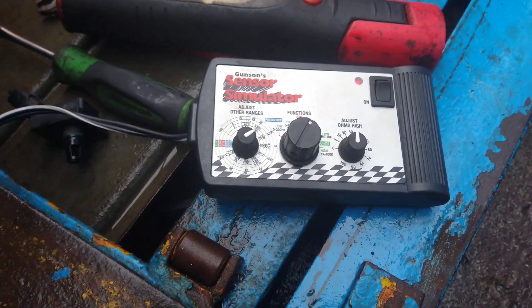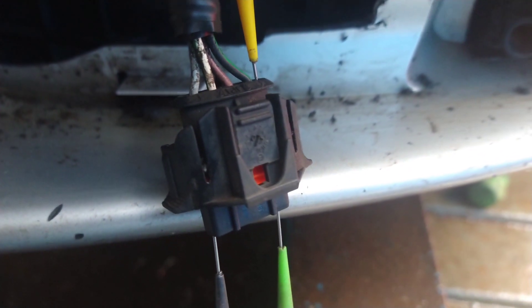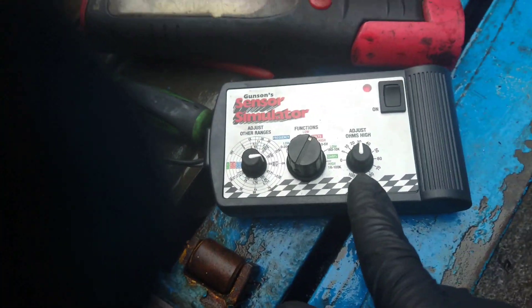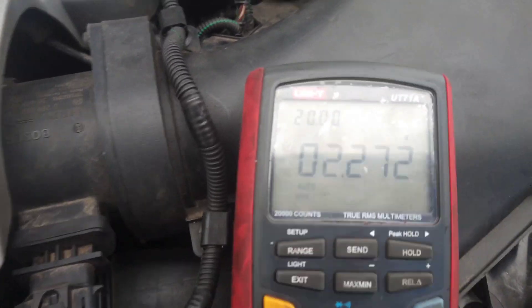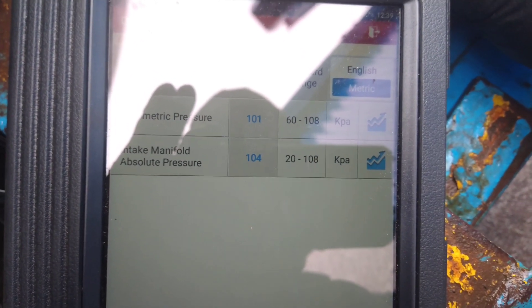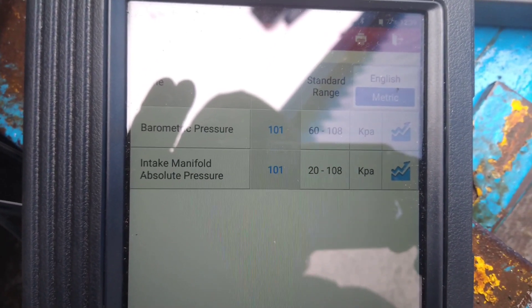Adjusting the voltage on the simulator — I can see it's the black wire with a green tracer. I've still got the voltmeter in, and at the bottom I can see the power and ground from the sensor simulator. I adjust it until the voltage is about right, aiming to get the red wire reading similar to the other one, and I adjust both to match.